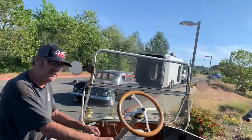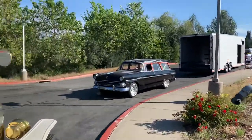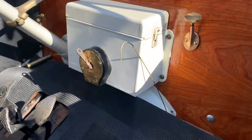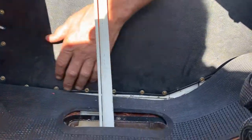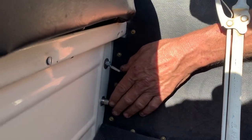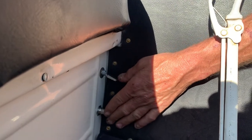Eric's going to show us again from a better camera angle. Throttle position is about there — we're on battery. There's the starter button; the light switch is above it. Make sure the brake is all the way engaged, all the way back. If you're starting cold you're going to give it a couple turns with the choke, and then look how that starts right up.